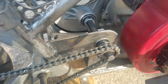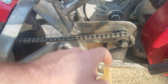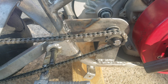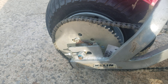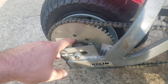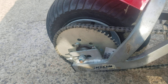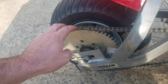The 5/8 shaft comes out of the backside of the torque converter, so essentially it gets like a jackshaft. I made the mounts, welded them on there, reinforced them at the bottom. This sprocket up here — I forget how many teeth, I want to say it's like 15 — 15 tooth number 35 chain going back to a 60 tooth sprocket. It fits right over the freewheel that's on this thing, with around a two-inch inner hole diameter. I'm not sure if I like the freewheel on this or not — it makes for a weird riding experience.